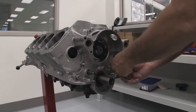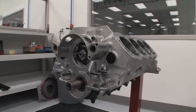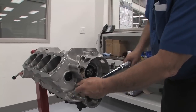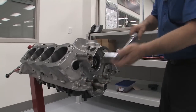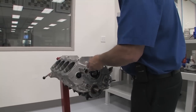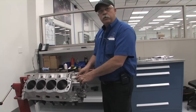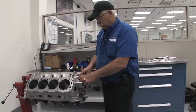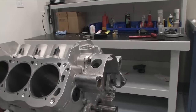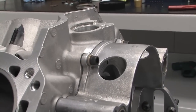There's even a bracket for a traditional fuel pump. If you're running either an electric or a cable-driven pump that mounts elsewhere, you can omit this step. Once the front cover is in place, you can torque the bolts to 25 foot-pounds. The kit also includes two socket head bolts required at the top of the cover — torqued to 18 pounds. That's a 5/16 bolt. You have to run a 5/16 Allen with a flat washer and a lock washer to clear the cover. You cannot use a standard hex head bolt on the top — it needs to be an Allen, and that will be in the kit.